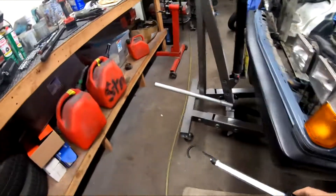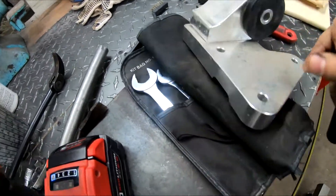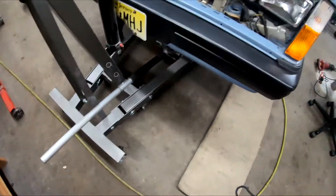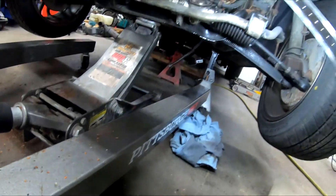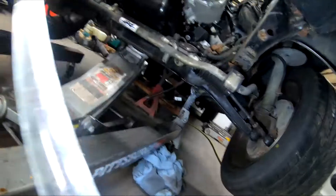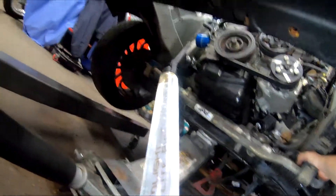I need to make spacers for the subframe. I'm thinking about using this piece of aluminum and creating two spacers, then buying longer bolts. If I have a spacer here that's an inch, then I'll be fine — it'll raise the motor up so it's hovering over the subframe.